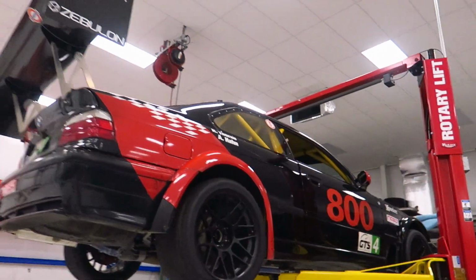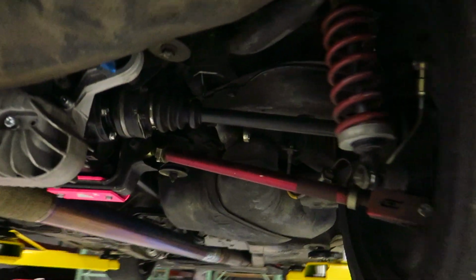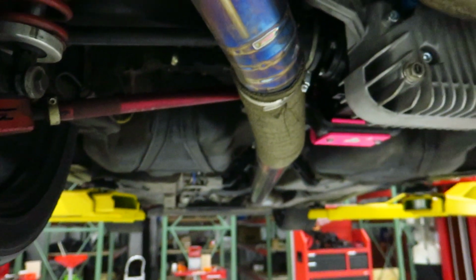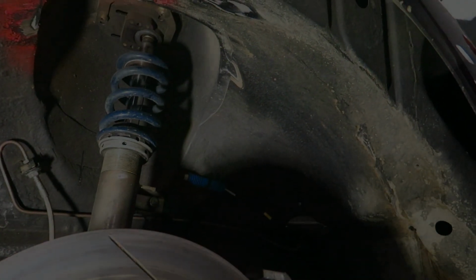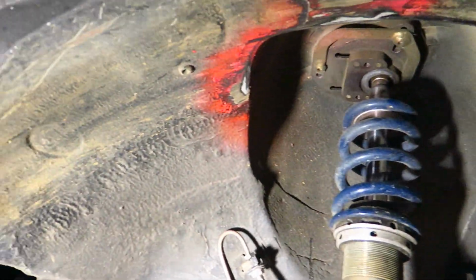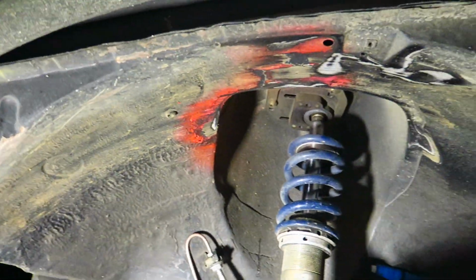All right, we got the BMW up in the air. Everything under here is looking pretty good. There is one thing that concerns me. Here's the rear tire. You can see a little bit of a mark here where we're probably catching one of these fender flares a little bit, so perhaps a minor clearance issue there. But worse than that is the front left, and now that we're generating more downforce and more grip, you can see there's this light line up here. Now take this with a grain of salt, but these tires have only been on the car for 2 laps. And if we get a shot up at the top, you'll see where it's rubbing pretty bad, and I painted those before we went out.